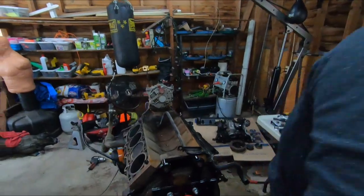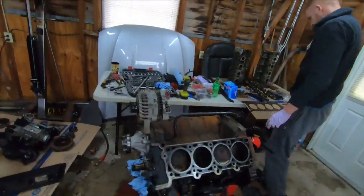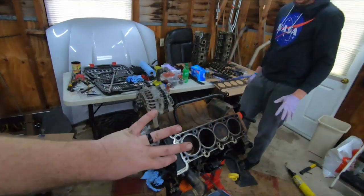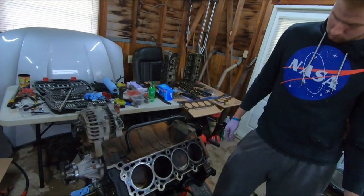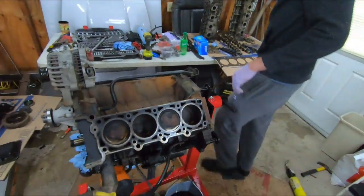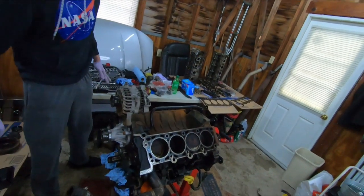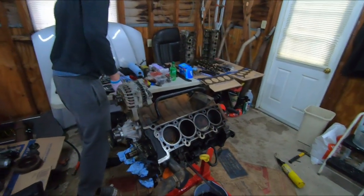We're gonna get some head studs, some ARP head studs and everything. We'll take this bottom end apart next time. That'll be the next video. We'll spin this thing now that we got a lot of the weight off of this guy. We'll spin this thing over, take the oil pan off. We'll go ahead and pull the rods and pistons out of this thing, get it down to a bare short block so we can bring it over to the machine shop.